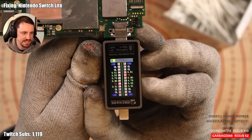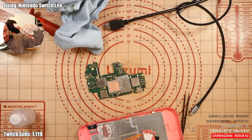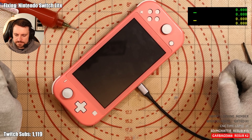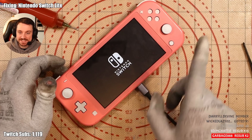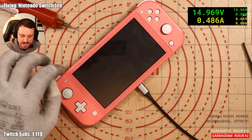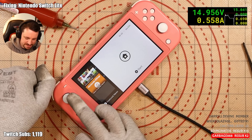08 and 17 show as red on the tester — so all we should have to do is reassemble. I'm probably not going to do a better job than Gibbs at reassembling at this point. Let's get it back in the chassis and see if it works. I did say I might have to replace one of the analogs — I might as well replace both. So why does it look uneven? I've changed out one analog stick and obviously we need to change the other one as well. Do we at least get something on the screen? Here we go — 3, 2, 1. False alarm, false alarm. There we go. Oh, you guys aren't even going to see it now. You can see it's charging at 600 milliamps. If I take this out and turn it around, we also get charge. So it now works both ways — great success, we've done it. I just now need to replace the other thumbstick. I'm starting to come down with a little bit of a cold so please bear with me, but that Nintendo Switch Lite is fixed.